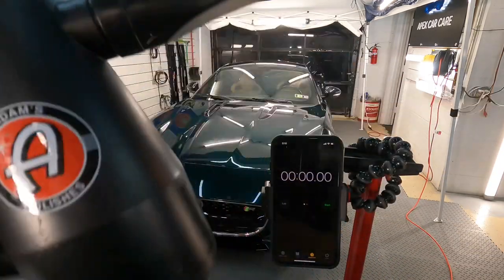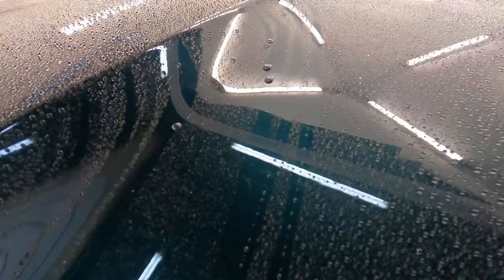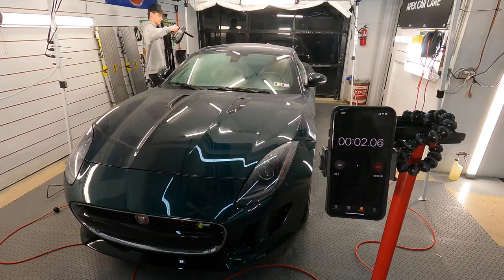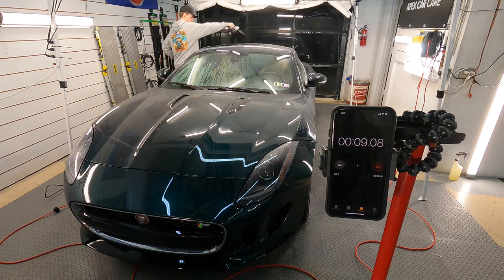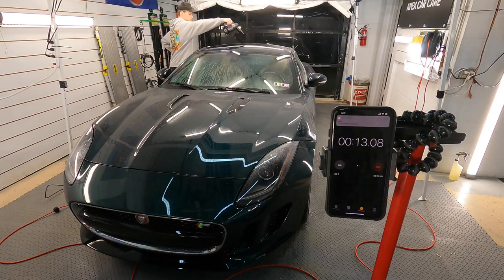Now for the Adams mini air cannon — as you can see, the vehicle is soaked. We just backed it out into the rain and brought it right back inside. When it comes to drying vehicles that come in for paint correction, we'll use drying towels because at that point there's no protection and water just seems to stick. With forced air, the huge drying towels take less time, but there's always a chance of marring. So when a car comes in for maintenance and is protected like this one, we always use the forced air contactless drying method.